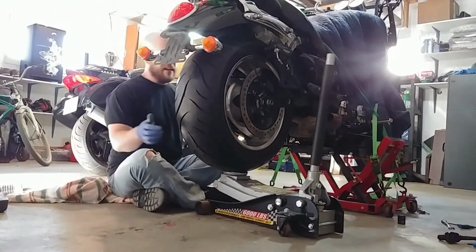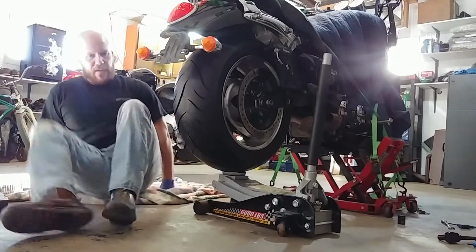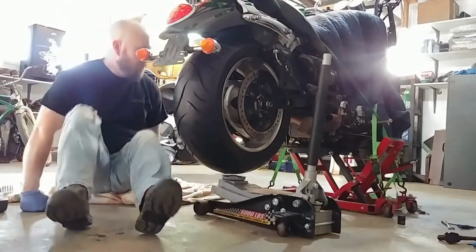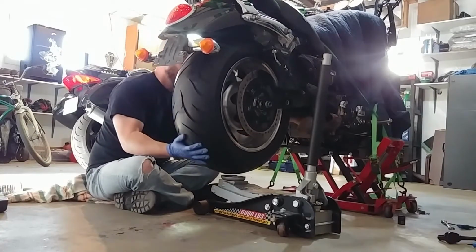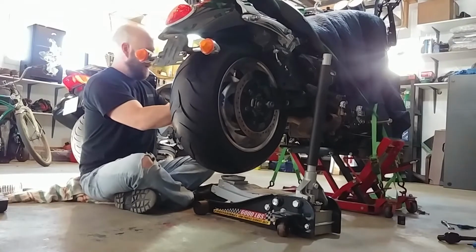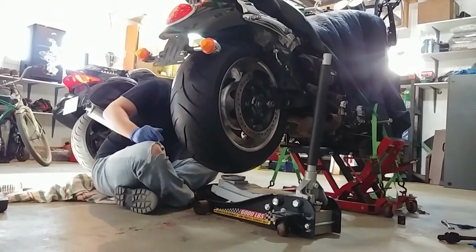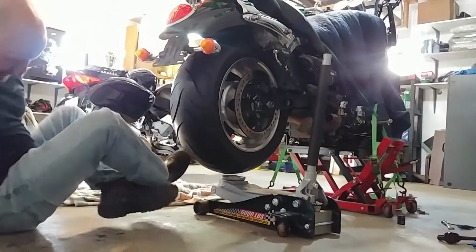So I'm going to put it into gear, and you can just gently slide the wheel over. Actually, it might be easier with the jack down, to be honest with you. I'll put the jack back in a second, just to support it. But okay, so now she's totally free. So you can now slide the wheel on the axle. There it is. It's impossible to show you, but it's obvious when it goes in. And now I've got it in gear. You can hear it, right? So it's fighting against the gear, which means those two teeth are mated. If it's not all the way in, it's going to be once we tighten everything up. So now I'm going to go back to neutral. Yeah, we're good to go. Okay, sweet. That's all there is to that.